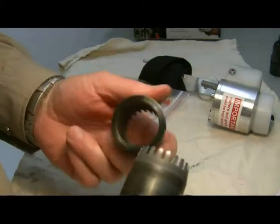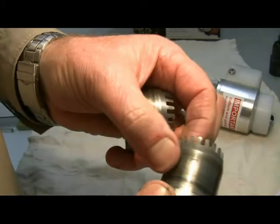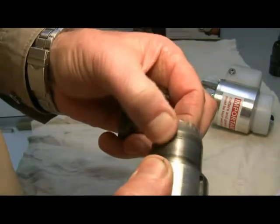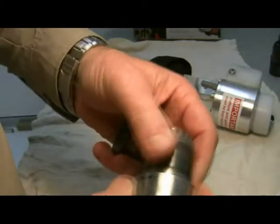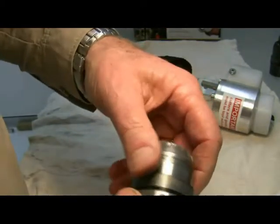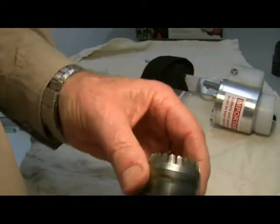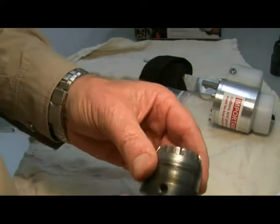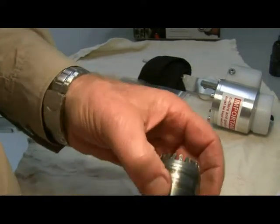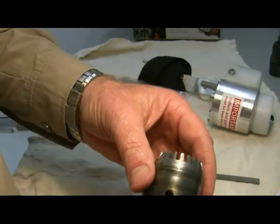Before refitting the cutters into the tail well, put grease around the face here. As you can see on this one, it hasn't been cleaned so well after being used, and as a result there's a little bit of rust starting to develop. By putting lots of grease in there, it just helps to ensure they stay clean during use. The other thing is to always use plenty of oil, particularly if you're in conditions where the animals are walking on sandy areas or they're bedded in sanded stalls.